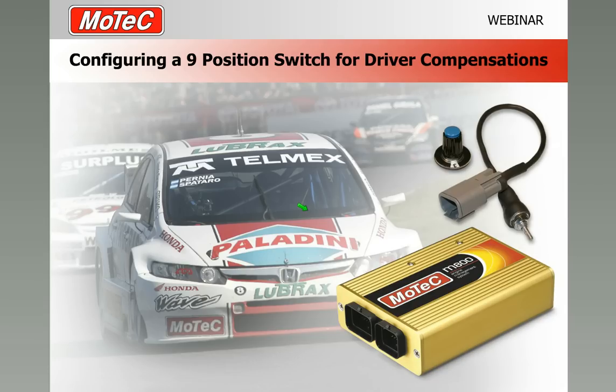It's almost identical to something like a throttle position sensor or a MAP sensor, other than the fact that you can put it in set locations and get precise voltages sent to the ECU, so we can have them configured to do precise things such as remove ignition or add ignition. You can make your own nine position switch if you want, or you can buy ours which has all the nice resistors and everything, made to last. The options are many.